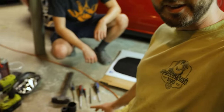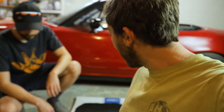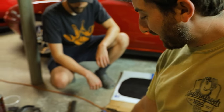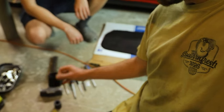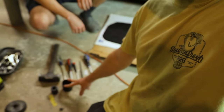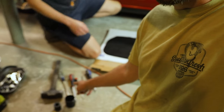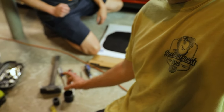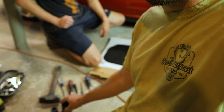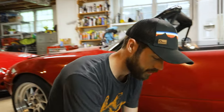On this one we're going to walk you through how to install it yourself on the passenger side. We have a few tools here that are going to help us out — mostly for popping out the little pre-cut plastic holes. You'll need a socket or some press tools, something solid that you can lay the door panel over, because we're going to be punching these out with a screwdriver and a hammer. The opening on that piece needs to be big enough for the piece you're popping out to fall into.